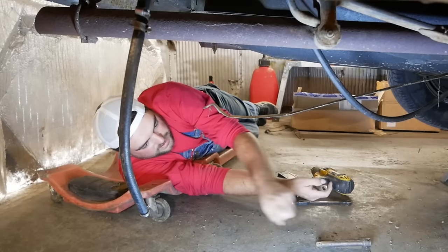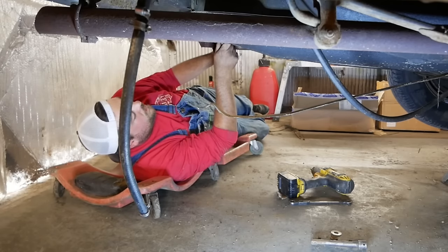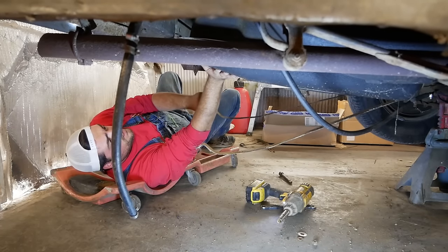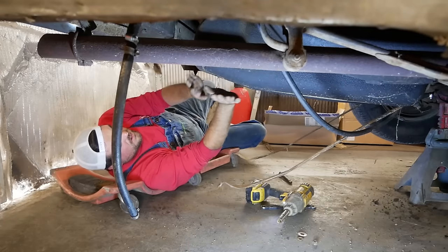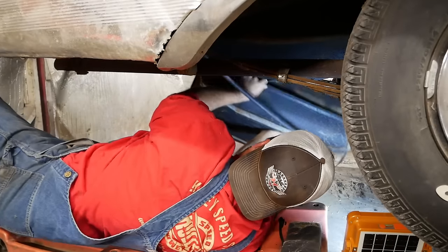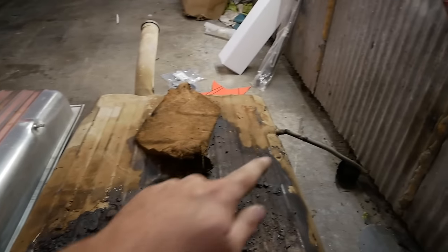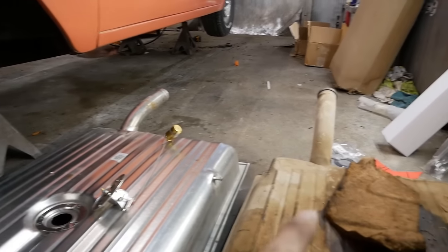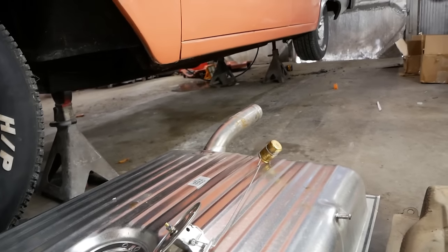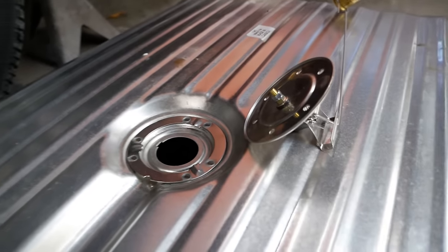This thing's full of bad gas. If I was smart I'd put a jack under it, but you guys know what to expect. Straps are free. The tanks are very similar — the vent's in the right spot. You can tell the bend of the fuel filler is different, but hopefully we can make that work with a little persuasion. However, the sending unit is quite a bit different.